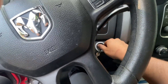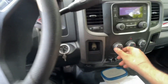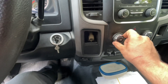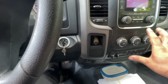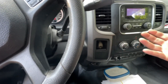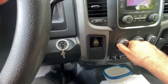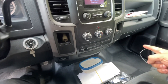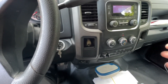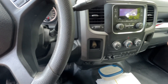We're inside the vehicle, key is in the on position — you can hear all the dinging — and check this out, the blower motor doesn't work on any speed. That's pretty much the same issue as my previous video where it was a connector on the bottom of the actual fuse box. I tried that and that wasn't it. The previous shop replaced the blower motor and the blower motor resistor without any luck, so they brought it over to me. Let's go to the front where the fuse box is and look at a wiring diagram.